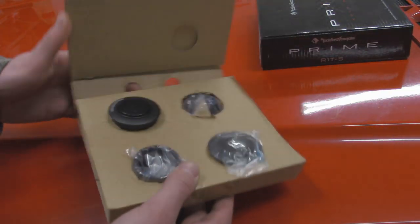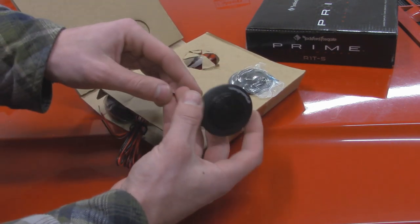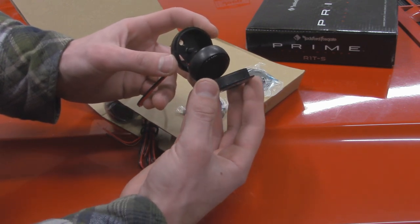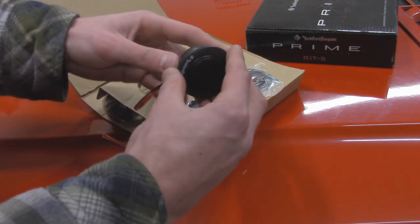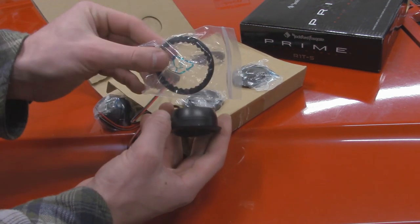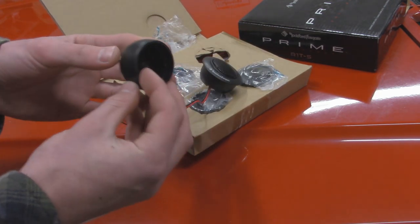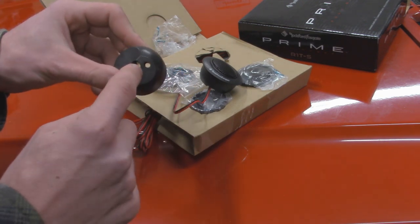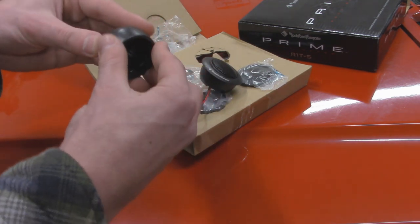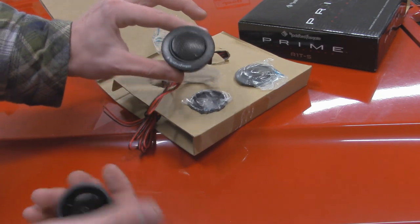Looking inside, we've got our two tweeters. This is the flush mount we're going to be using. The way these come apart is they just twist a little bit and then they come out in two halves. This part goes on the back side and this goes on the front side to give it a nice clean appearance. To lock it in place they have these little clips on the back side that dig into the plastic for a nice firm fit. They also have these surface mounts if you want an external look — basically you screw it down to any surface at a 45 degree angle and pop in your tweeter. But today we're just going to do the flush mount because it looks a lot better.